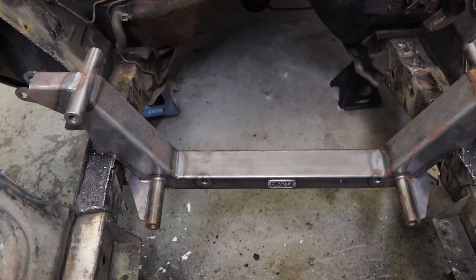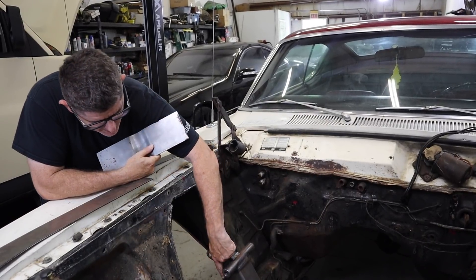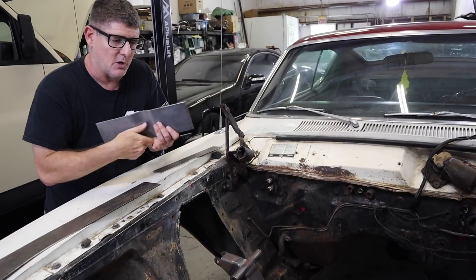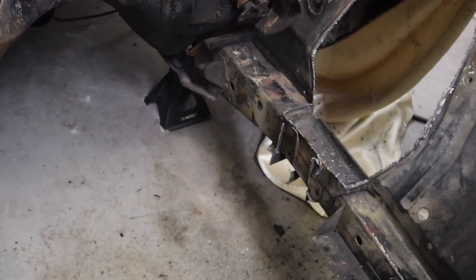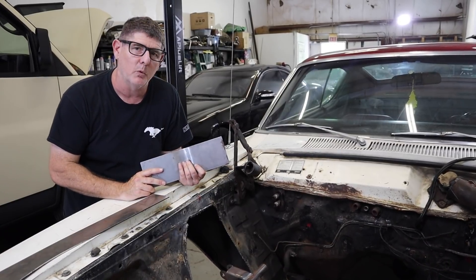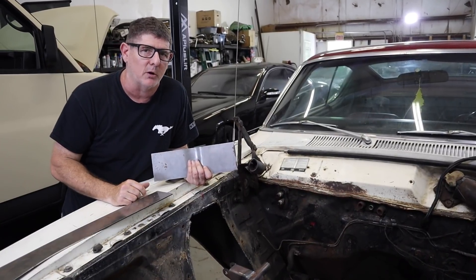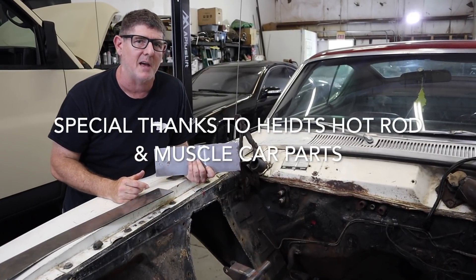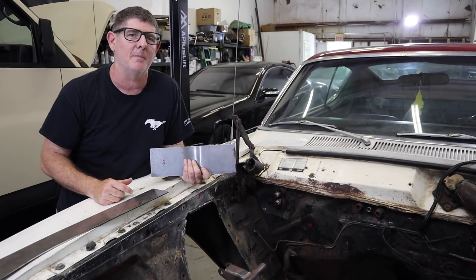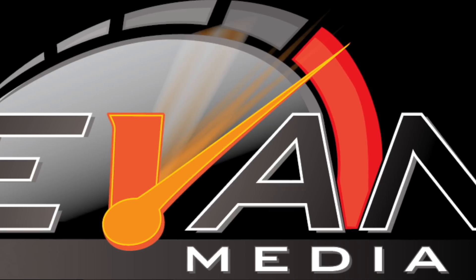Alright guys, so we laid the crossmember into the car. Once we get everything ground down and cleaned up, Abe will do some cutting and slicing. This notch right here is where the crossmember will sit on the frame of the car, and there's a whole bunch of thick plates that get welded into place to support everything. We're going to cut it for today — did a lot of work, I feel really good about the progress. This is part one of the 7-3 going into the Cyclone. Thanks for checking out the channel — be sure to subscribe, like, and drop us a comment. I'll see you next time.